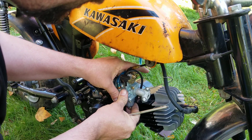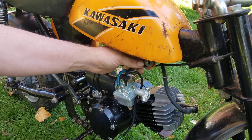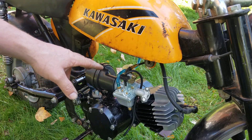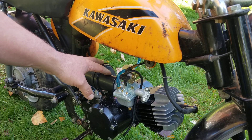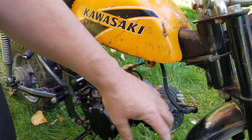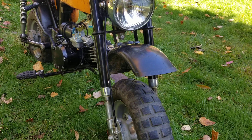I just need to rotate this carburetor a little bit, just like that so it sits flat, then tighten it up. I have not adjusted this carburetor or done anything to it. This is a Chinese carburetor — I paid 21 bucks for it brand new on eBay and it came with the whole air filter assembly. The KDX50, the LT50, and the Junior 50 all take the same setup, so it's the same carb. It's been sitting with fuel in it, so we're going to try it without the choke, see if it fires. I'm not going to run it long because it's got no exhaust on it.